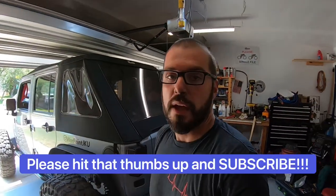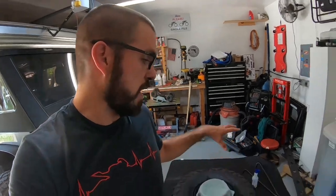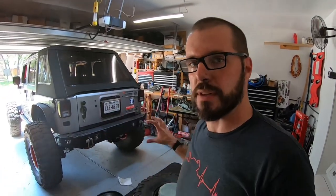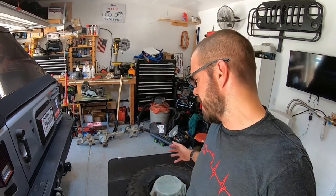Position the tire so you can see where it wants to come off, put a little weight on that spot, and slowly work your way around the tire — it'll pop right off. I was able to get the wheel out of the tire doing exactly that. Sometimes you might have to use a couple of pry bars. With this Yokohama XMT 40, the sidewall is so thick I got about a third of it out and couldn't get the rest. I stuck a pry bar between the sidewall and the wheel at the edge where the bead ring bolts, soaped it up real good, applied steady easy pressure with leverage, and boom — it popped right out. I've done tires before where it just pops right out real easy, but the XMT in a 40 has a really thick sidewall and a high load range rating — it made me work for it.